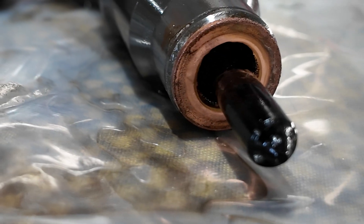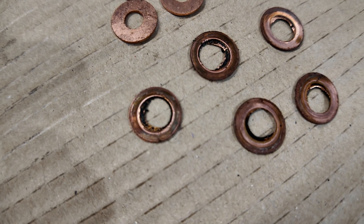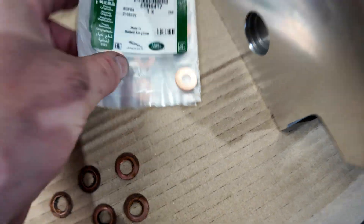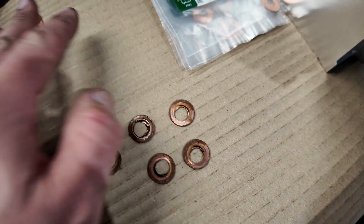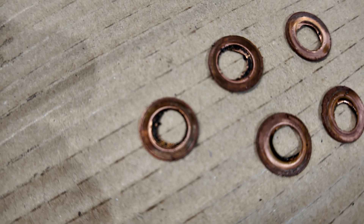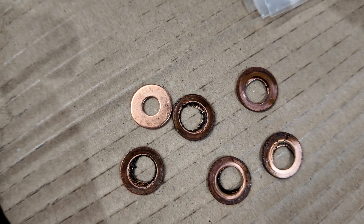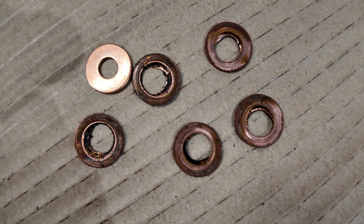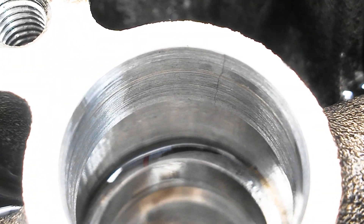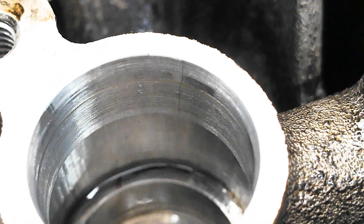We'll need to revisit whether these injectors are worth using again. Just having a look at the old injector seals — ignore those ones, they're not genuine. We're fitting a genuine set of seals, of course. These just come with the packaging when you purchase an AMC head. You can see what's gone on — completely blown the seal out on all five. There's quite an obvious crack in the head in the injector port.